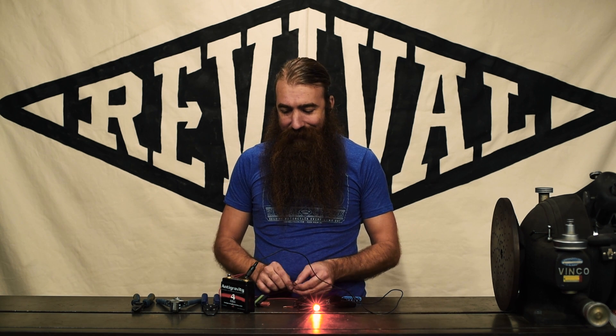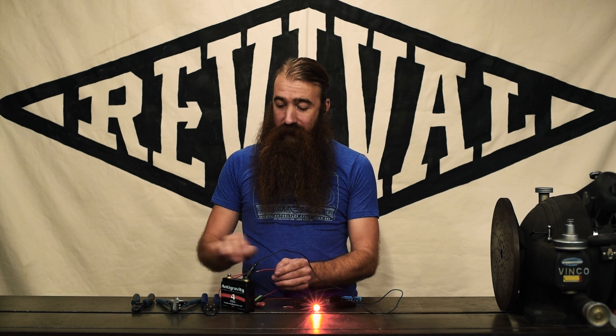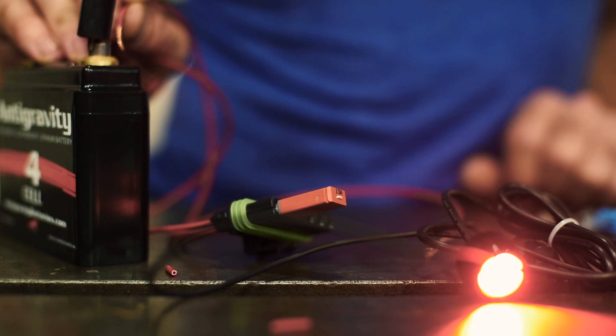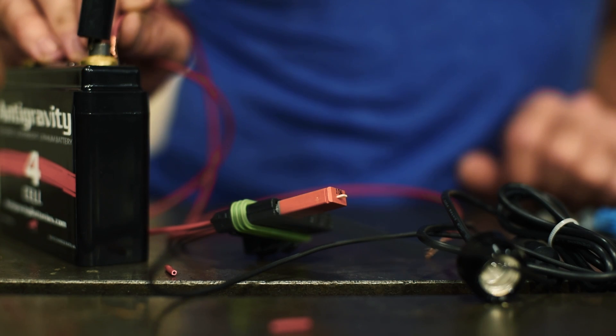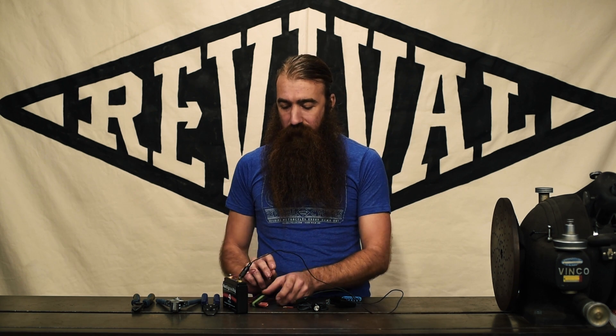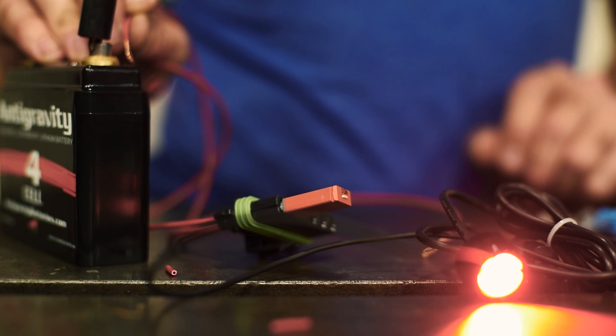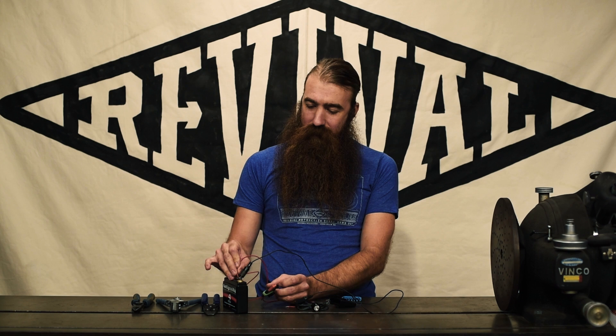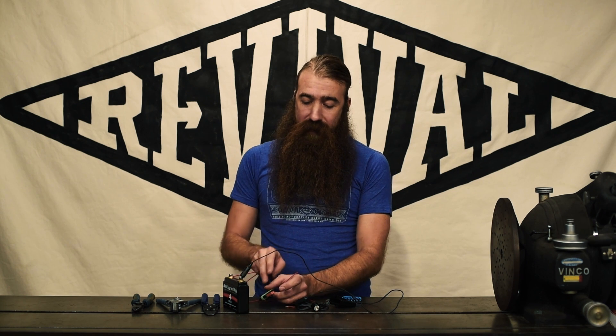Now to simulate a short circuit — that's why I added that second wire to the second terminal. I'm going to give a dead short to the ground side of this terminal. This would simulate what would happen if on your bike you had a really bad short circuit — probably worse than you'd ever have on a bike, but it's great to check the worst case scenario. Short circuit. This wire didn't get hot, nothing lit on fire — that's the whole point of circuit protection, it keeps things from lighting on fire. With the manual reset circuit breaker, this little white tip just popped out maybe an eighth of an inch. To reset it, just push that back in. Circuit's back alive — easier than changing a fuse, and if you didn't have a fuse, it's way easier than walking home. We'll do that short circuit one more time just for fun. There you go — that's the manual reset type of circuit breaker.